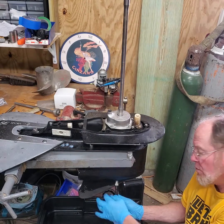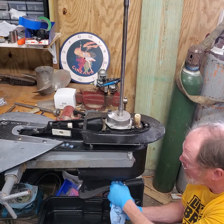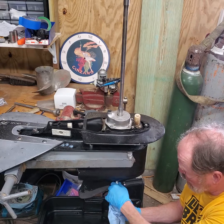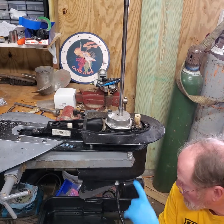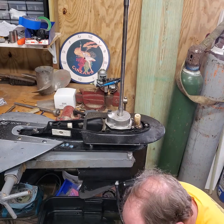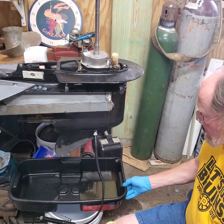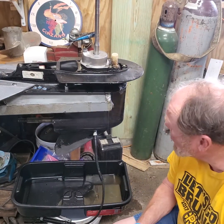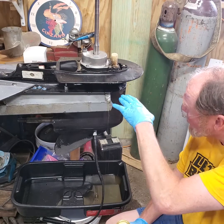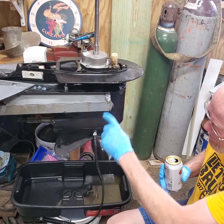I pressure tested it and it was fine. Ready now to fill it back up with gear lube. We're just going to fill it up until it comes out the fill hole. I'm going to put the vent plug and the fill plug back in, then pull it back out when it's full — it's coming out that fill plug. I'll wait until it's level with that fill hole. It came out the vent too.